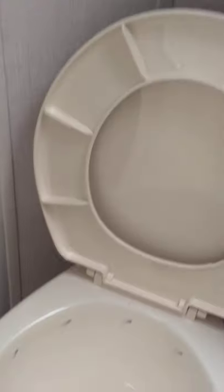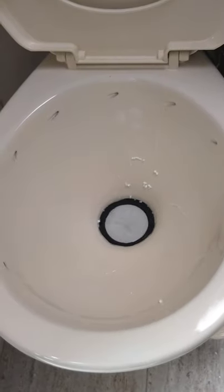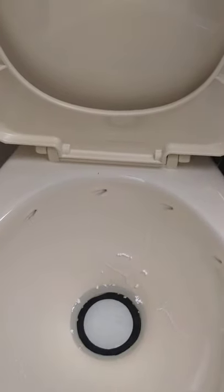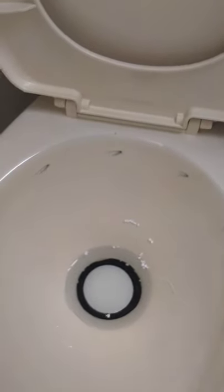It's even got a ceramic toilet. This has just been water tested so that's residual water. Directly below here is the black tank. You can't use this toilet dry to start. The procedure is: pull up to your campsite, hook up your water and power, then come in here. Take your chemical — whatever you use, powder, liquid, pre-measured packet — read the directions for dosage and put a dose right in here. Then step on the pedal — water will rush out — and add about a gallon or two of water to get started. You can't use it without chemical or dry.